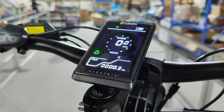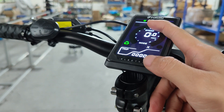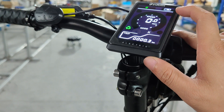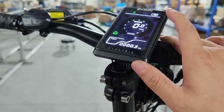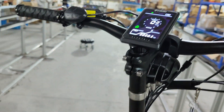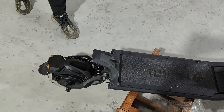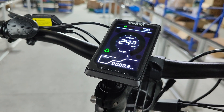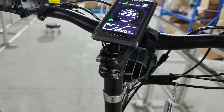When the mode indicator is on, it means the speed limit is active on the scooter, and it does three things: first, it limits speed; second, it activates PAS, which means you need some speed to activate the throttle; and also cruise control is off regardless of the setting. It's for regulation. If I press the throttle it doesn't work — it requires a kick to work. The maximum speed is around 24 or 25 km/h, and cruise control is off.